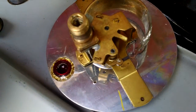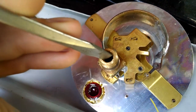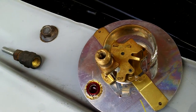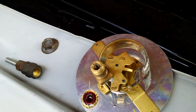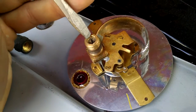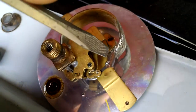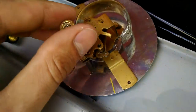Once I did that, I addressed the fact that it was very muffled in response to engine acceleration. When you accelerate, you lose a lot of vacuum, and for whatever reason the factory installed a screw inside this port right here. Think of it like a mute for a trumpet — you can still play the instrument but it's heavily baffled. That really restricted its responsiveness, so I took the screw out.